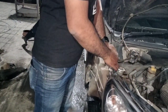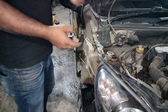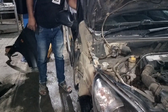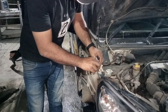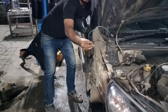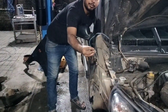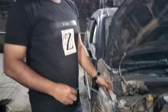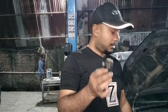Now I'll be using the wiper and showing you. You can see the bulb lighting up every time I use the wiper. This means the wiring is perfect — this motor is getting adequate current — but this motor is defective and we need to change it.